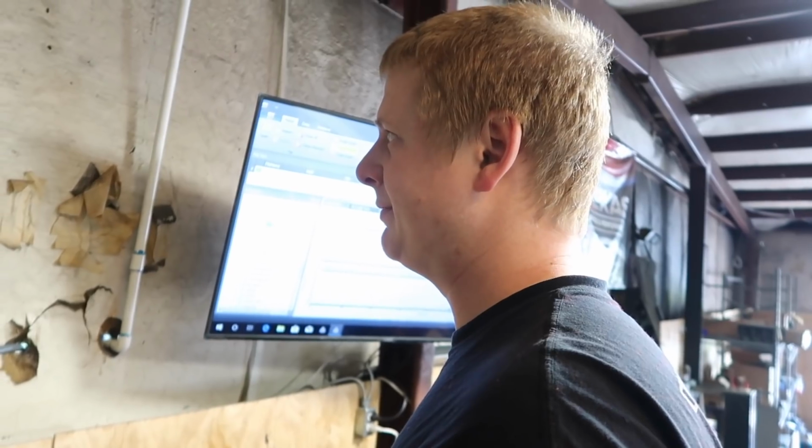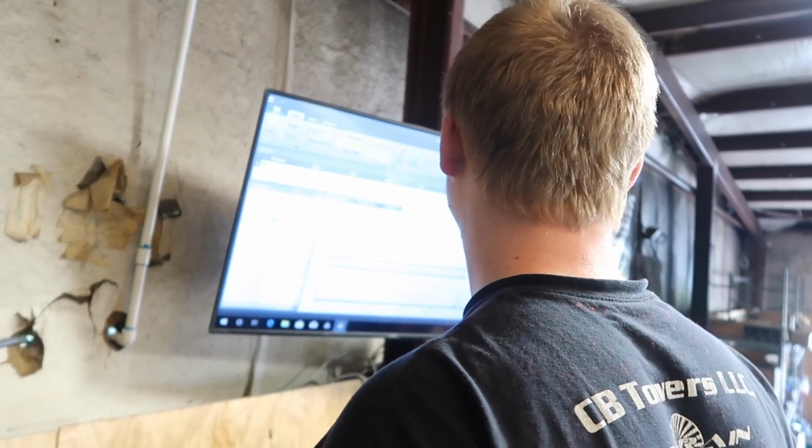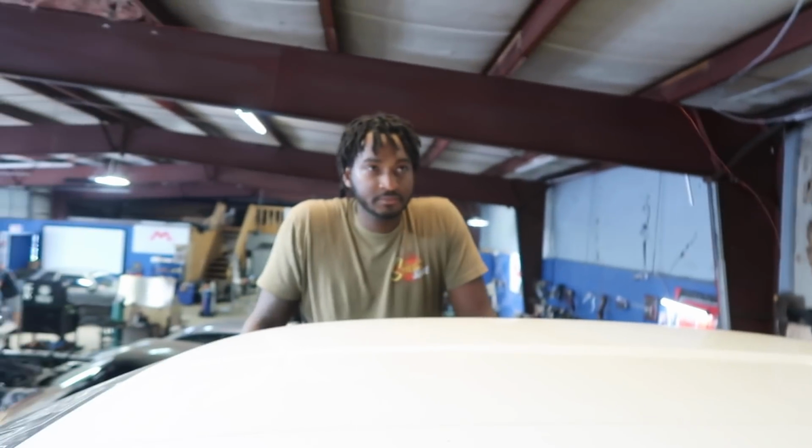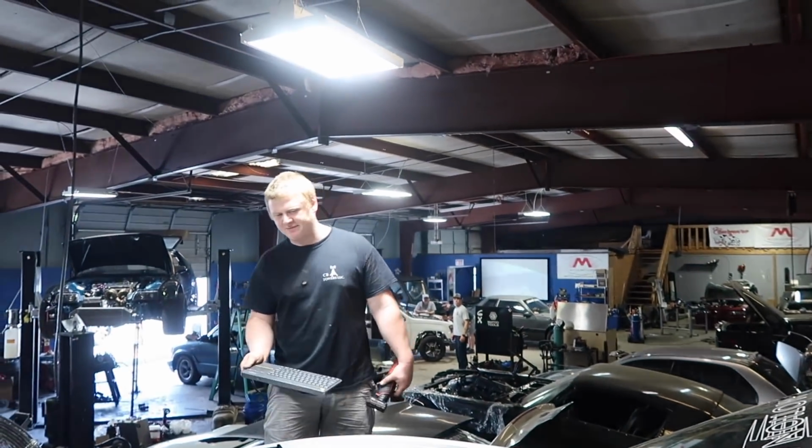Do you want to try it at the same level and add a bunch of fuel? Yeah, add a bunch of fuel. Ben told me if it goes between 12.0 and 12.5, pay attention, and I had no idea what number it was. That could have been 14, and I had no clue. Are you logging fuel pressure on it? No. You can log fuel pressure with HP Tuners, but I don't have it set up. I just got a manual gauge. So stand there like this with a flashlight. So you got a gauge? Yeah, all you got to do is have somebody...